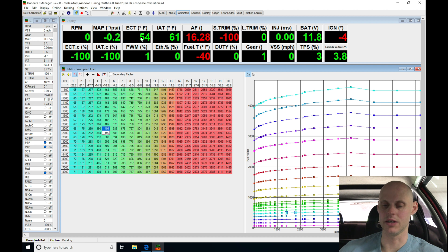Looking through the rest of our setup, we see our ECT or engine coolant temp at 54 degrees and our IAT at 61 degrees. Ambient temperature in my garage right now showing on my dyno is approximately 68 degrees, so these are reading ballpark to the ambient condition — that's a good indication that our sensors are accurate. I have seen cars where the air temp was reading negative 10 degrees Fahrenheit when it was clearly 60 or 80 degrees outside. In that case, even if it's not throwing a code, I know I have a bad air temp sensor and need to replace it before continuing the tune.